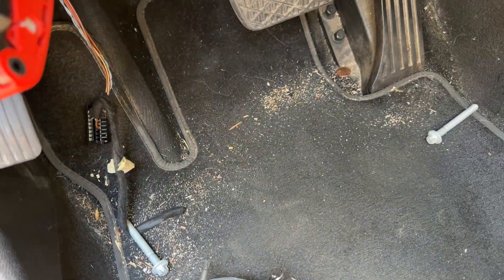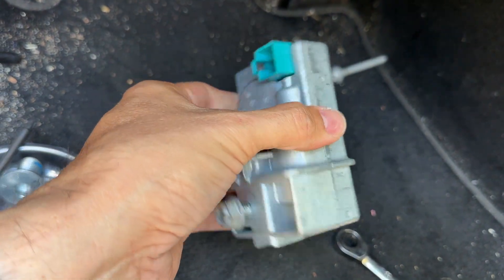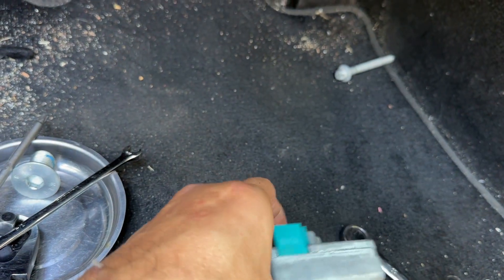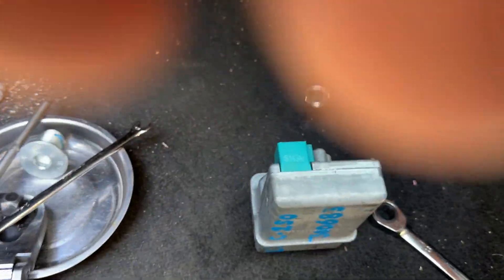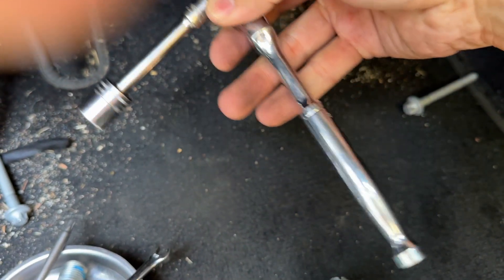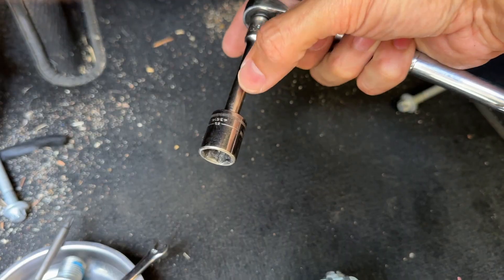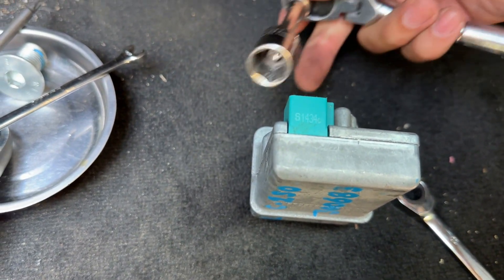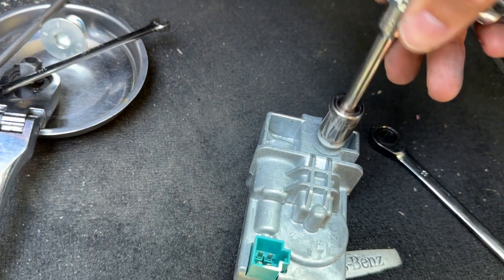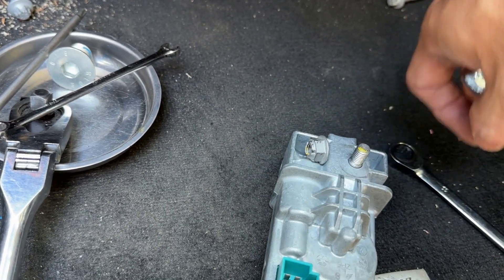So I'm going to jump in here and get the steering lock out. Here I have a sample one — this is one that I got out already. This is a steering lock. It's sitting in the column like this, backwards. You've got to get your hand around it from the right side like this and get your small quarter-inch ratchet — mine has a swivel head, that's probably best for this job. I've got a 3-inch extension and a 13-millimeter for the bolt on this thing. You're just going to wrap around it, feel around for the bolt — that's a 13 mil — and just loosen it up. Once you get it loose, you can do it by hand. Depress the bolt and pull it up and out.